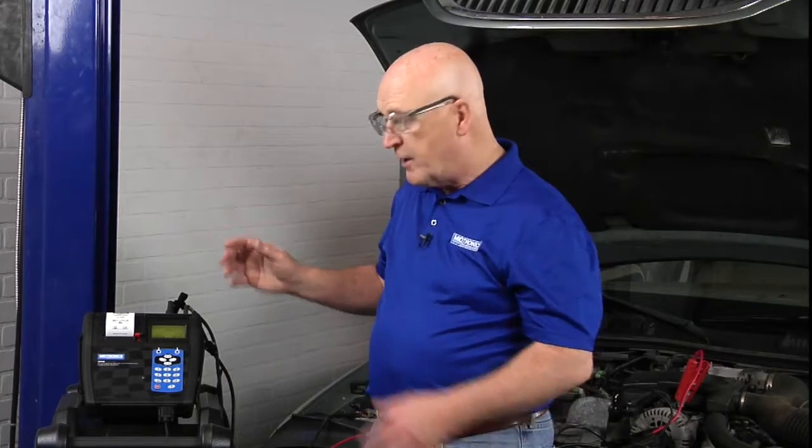There are a couple of things none of these tools will ever have: eyes and ears. We need the professional technician. If you hear a starter that's got misalignment, or it's growling or howling, you know there's more work to do. But in this case, we can at least verify that the circuit is intact. There would be a real problem if you put a new starter in and still had a slow or hard crank because of a bad cable set or corrosion on the negative terminal. This is one way to eliminate that possibility quickly and safely, without getting out your multimeter and cranking the engine. This does it automatically.